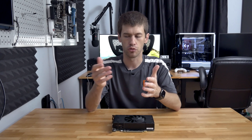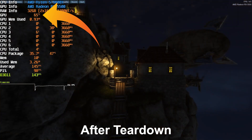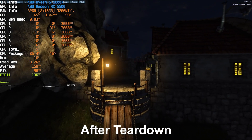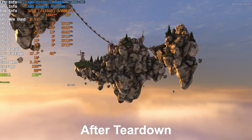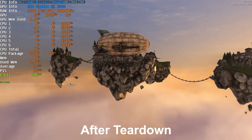The last thing to do after replacing the thermal paste with the MX4 is to take a look at another Heaven benchmark run — and there's basically no change whatsoever. The thermal paste applied is just fine in the short term, though as with anything that uses thermal paste, after a couple of years you'll probably want to replace it. Over time thermal paste can dry out and temperatures will start to creep up — though fortunately with a card like this it's very simple to pull apart and replace the thermal paste.